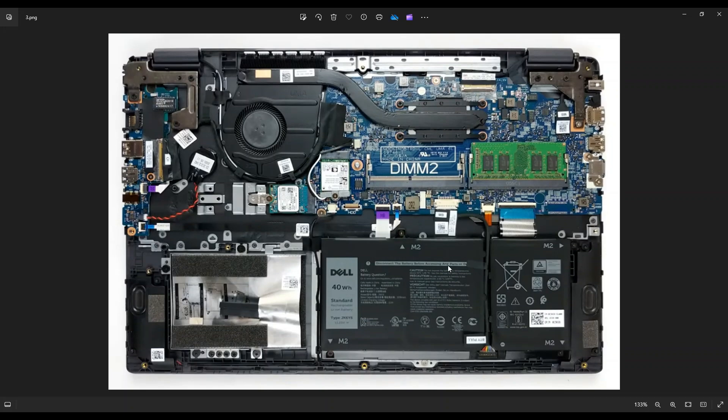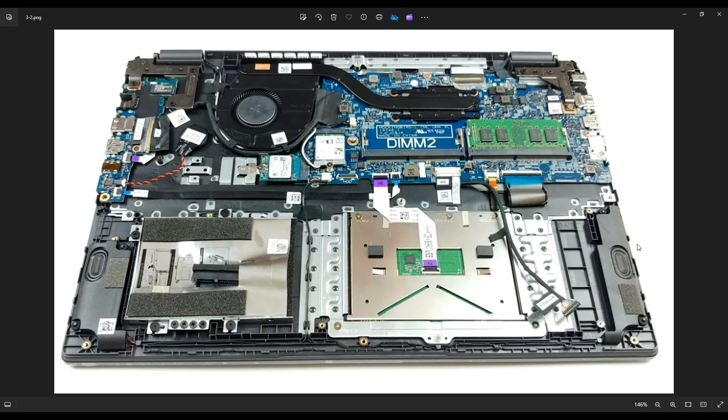And that's how you would get your battery out. Now that the battery has been removed or at least unplugged, it's safe to proceed deeper into the computer. You have two locations for storage here. You have this hard drive caddy right here that's screwed in — four screws are holding in this hard drive caddy, which you could attach to a SATA 2.5-inch drive. You could do a hard drive or a solid-state drive. The hard drive connector is right there and it'll plug into the motherboard here in the port that says HDD for hard drive. In the link below in the description, I'll have some hard drive options in there for you.